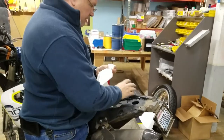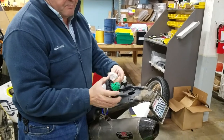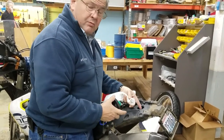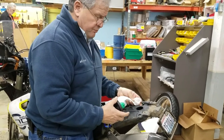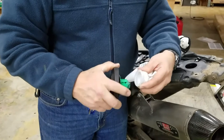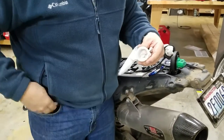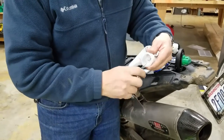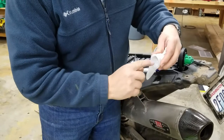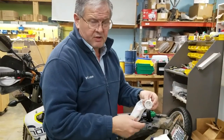When we did this process and tested it, we ran into a bit of a hiccup — not something that can't be solved. With the gas cap that comes on the bike, it's got this green portion right here, and when it's sitting down inside it won't go into the tank itself — the cap has to nest in to a small amount. We found that the sharp edge of this flange prevented the cap from going inside. Being Yankee engineers, we took a pocket knife and eased this plastic a little bit to create a funnel, making sure any scraps fell to the ground and not into the filter.